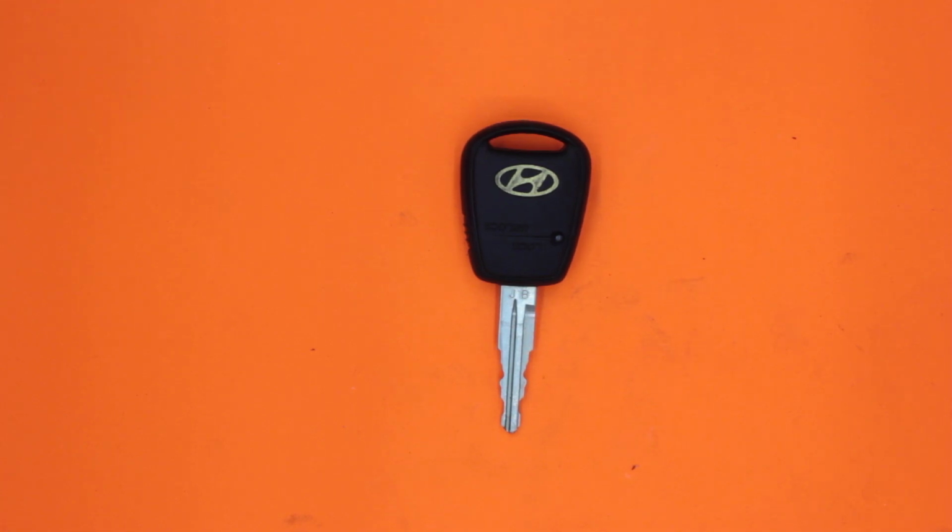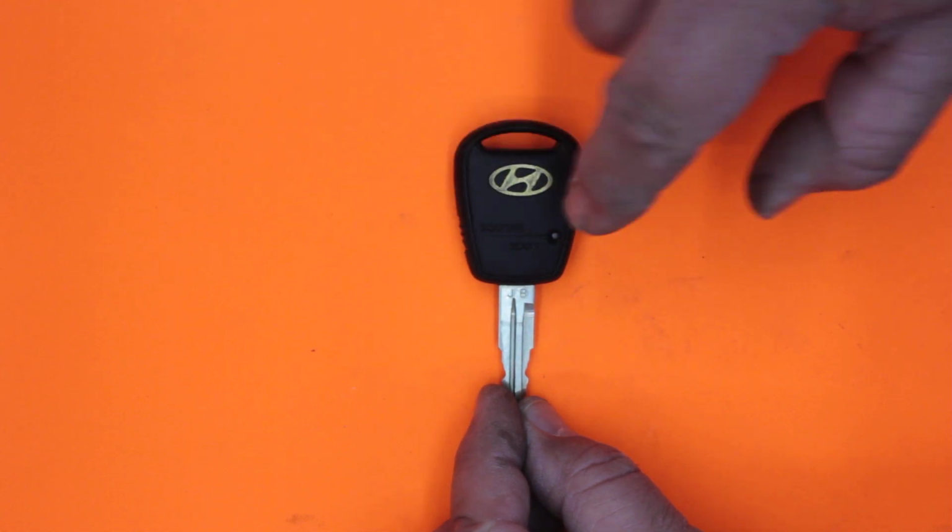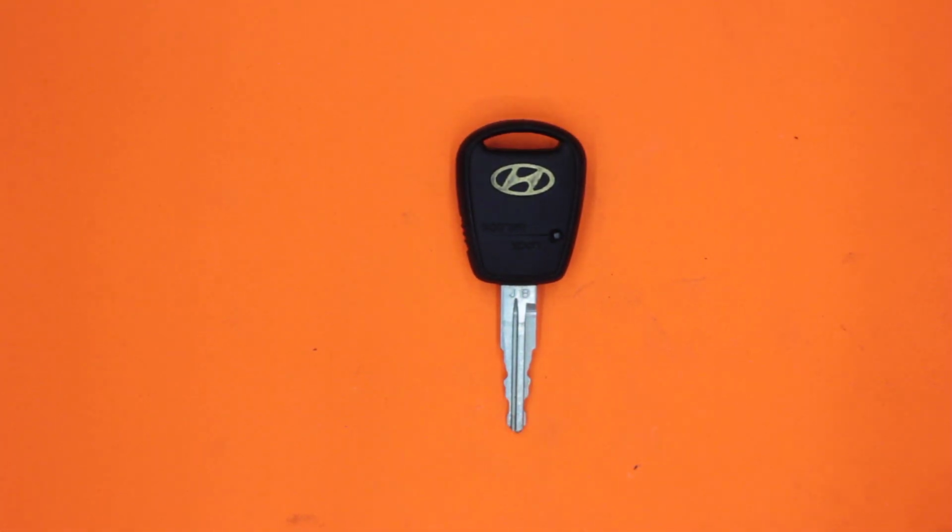We're looking at a Hyundai Accent 07 model key remote. Now, they do come out on iLoads and various other models, so if you know a model that has the exact same key, if you could leave it down in the description, it always helps us locksmiths cross-reference. Now, this particular one here, when I push the button, I'm not getting any light, so it could be a good indication that the battery is actually flat or the remote is broken.